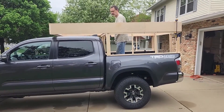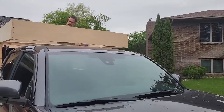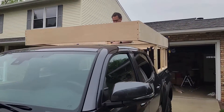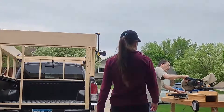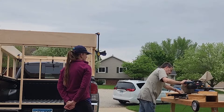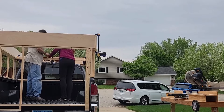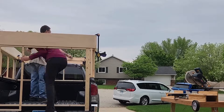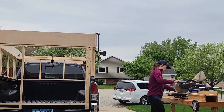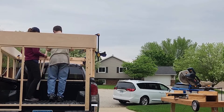This is a fairly modular build — each of the four walls on the base come apart attached with angle aluminum, and we made it so the bed support comes off as a separate unit to keep it manageable for two people to take on and off the truck. After the rectangular frame of the bed support was up on the truck, we cut a couple pieces of wood to support the middle of the bed platform — one on either side of the shark fin antenna so that antenna could stick up a little bit between them.